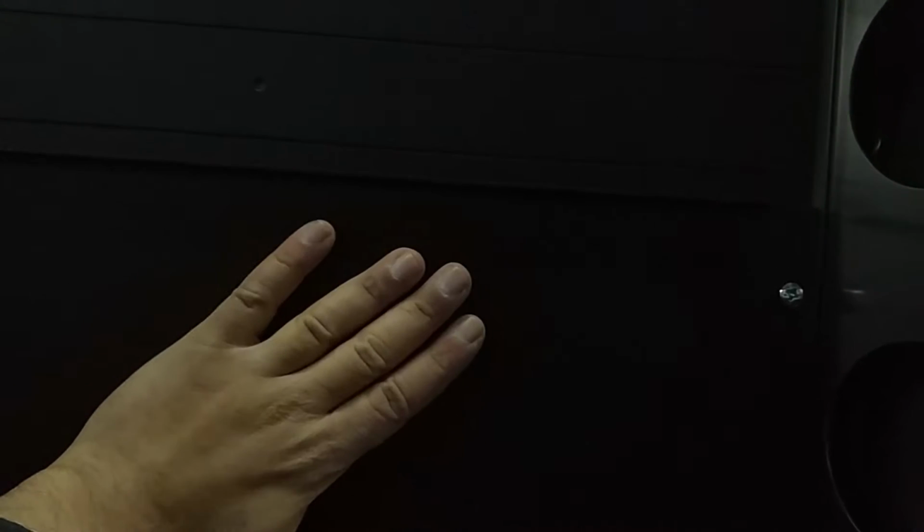The data center's idea was to block off all the gaps at the front. That way none of the hot air from the back can come to the front. I put my hand here and I can feel it quite warm, so that's about 30 to 40 Celsius. I don't have my thermal imaging camera here, but I'm just guessing. So it is blocking some of the heat, but because there's not enough airflow coming through these side vents, I think the ant miners are starving of air.